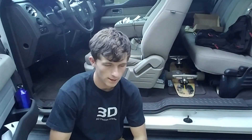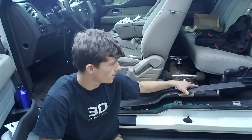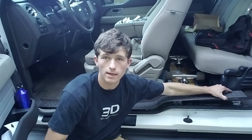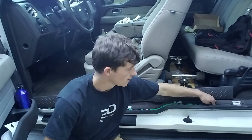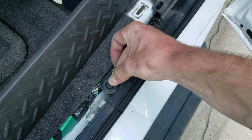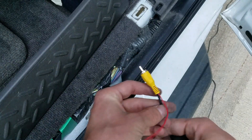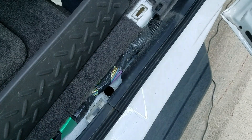I spent a few minutes trying to find a good spot to fish the wire through into the cab. I actually peeled this part off right here — there are just a couple of clips, take it off nice and easy and it comes out. And right here there's a little rubber gasket — you pop it out. So I removed the rubber gasket and you can see it's going to fit there perfectly. I've got to go from underneath and then come up there, then wire it all the way through.